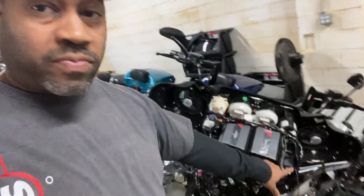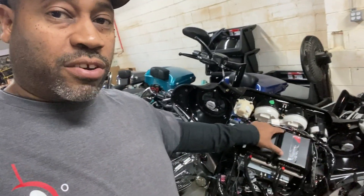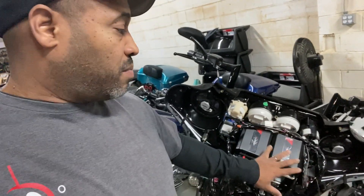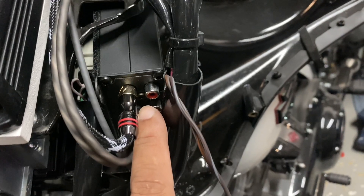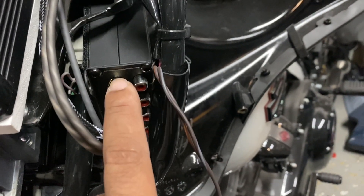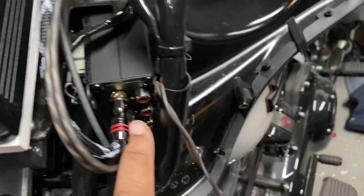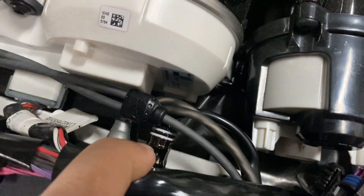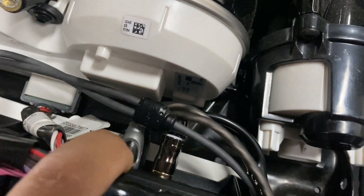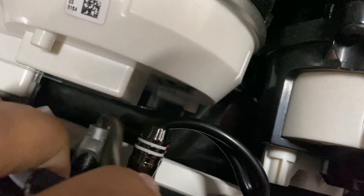HK Mini DSP in the pocket like we always do. The RCAs are perfectly run — no extra slack, it's beautiful. We gave the Rhino ones the easiest job: from the very first channel — channel one and channel two on the DSP, the closest — since it's the shortest we assigned that job to that one. There it is going into channel one and two. But you see how the RCAs are longer and it comes really close to the cluster.